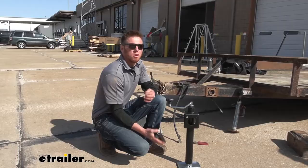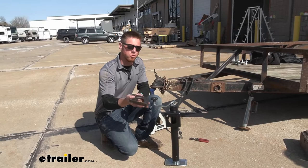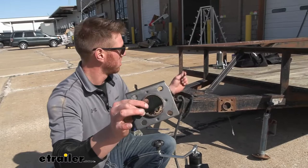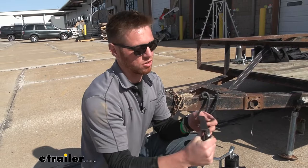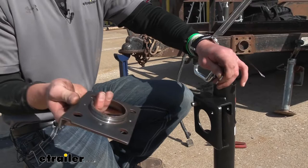First thing we're going to want to do is put a jack or just hook it up to your truck to get the trailer off the ground, and then we can remove whatever one we have before. If you do have another one of these already welded onto your trailer like we do, you don't have to use the one that comes with the kit, but it does give you one. When it comes out of the box it's going to be like this, and we just need to rotate it to where we can get this snap ring off so we can remove it.